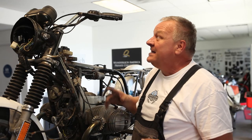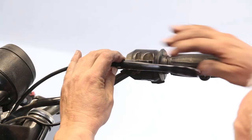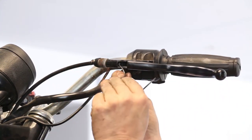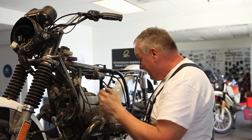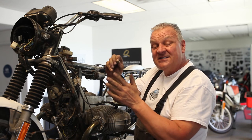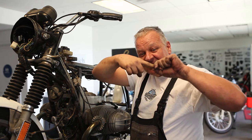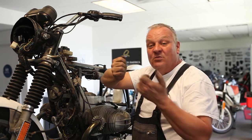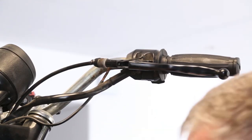Before attaching the clutch cable, it's very important to lubricate both ends. Go up to the lever, pull the barrel out and remove it from the cable. As you move the clutch in and out, the barrel has to spin inside the lever. If it gets stuck because the grease is hard and dirty, the cable starts bending back and forth at a changing angle, and over time — just like bending a wire back and forth — it'll break. That's why clutch cables usually break. So always keep this very clean and lubricated.